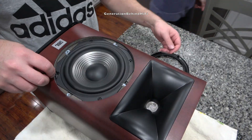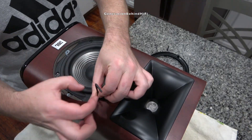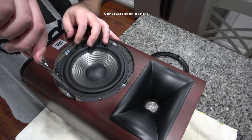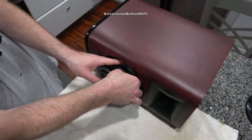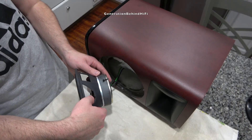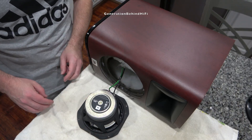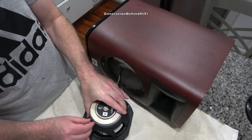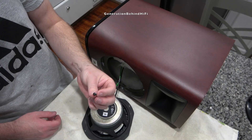After the beauty ring has been removed, I then use a 3mm Allen tool to remove the 4 bolts that fasten the woofer to the front baffle. Do you see the loose screw attached to the woofer's magnet assembly? Looks like one of the workers forgot to tighten a screw inside the cabinet or dropped one while they were assembling my speakers. Hopefully it will be obvious where this screw belongs as I remove more parts.